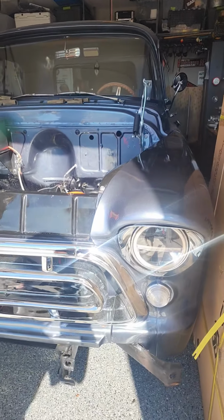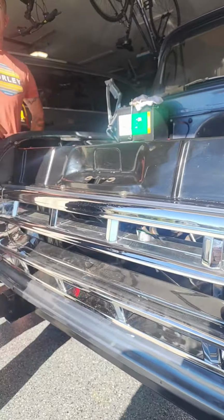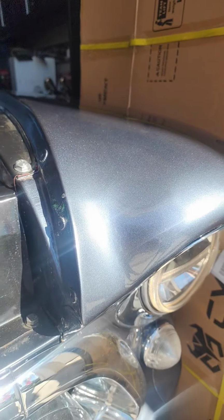Okay. Now, if I have a concern where what was under this paint, where it had its original adhesion, if I were to just DA it down and paint over the top of it, it is going to blow off the same because it's sticking to what this is sticking to.